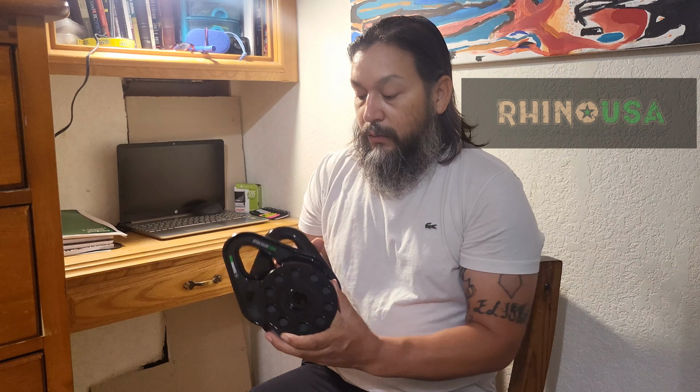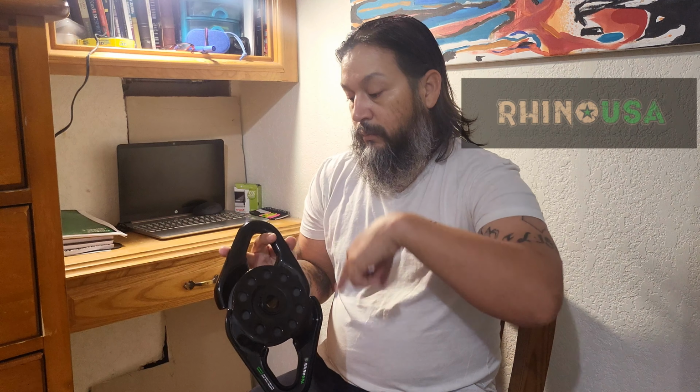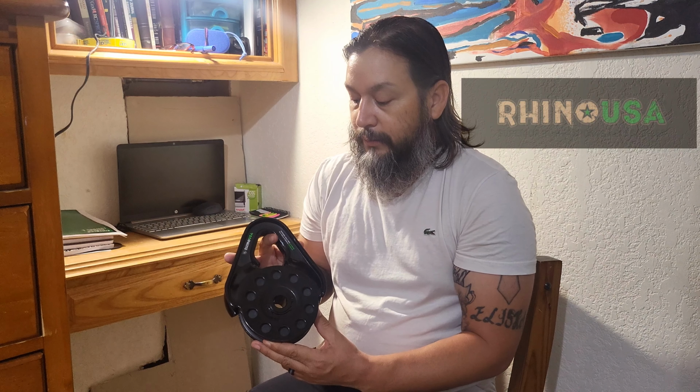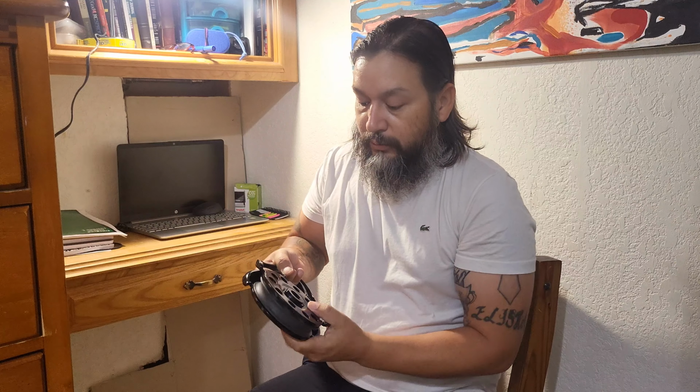And all you do is you slide one of the sides down, you run your cable, you close, what's called close the tool, then you run your anchoring tool to here, either a soft shackle or a metal shackle. You're going to run your cable back to your vehicle. It'll end up either on its side or perpendicular, maybe at a small angle, and it's going to aid you. Well, let's go outside and show you how we actually do it on a vehicle.